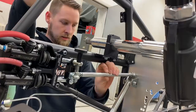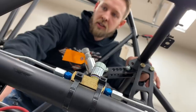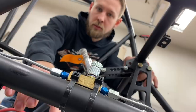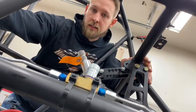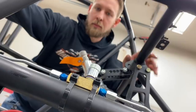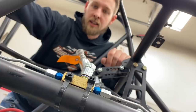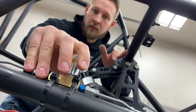The brakes bleed a little quicker, and then once you're done bleeding the brakes, you can adjust the pedal to a comfortable height for when you're sitting in the seat. I also went through and double-checked all of the brake connections. Even though these brake lines were installed from the factory, I wanted to make sure every fitting was tight. If you're installing these yourself, make sure you use pipe dope when you put the pipe fittings into your brake shut-off and other places. I'll put a little bit of grease on the threads of these aluminum fittings so that corrosion doesn't ruin the threads when you go to take it off someday. I steer with my left hand and this is a comfortable spot for me to adjust my right front brake shut-off, so that's why I've got it up high where I can reach it.